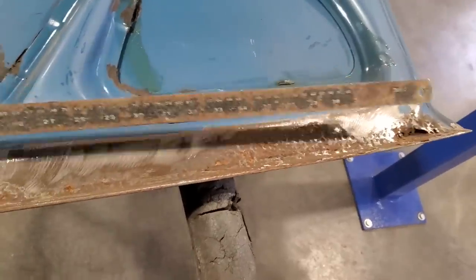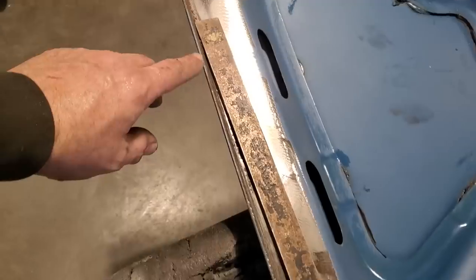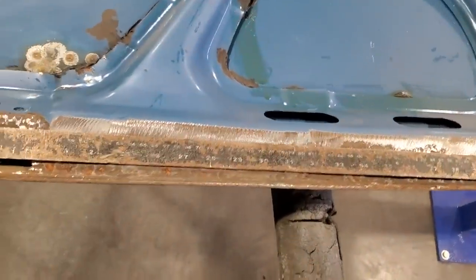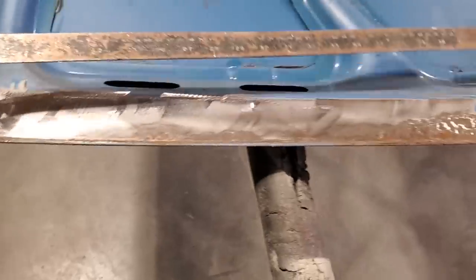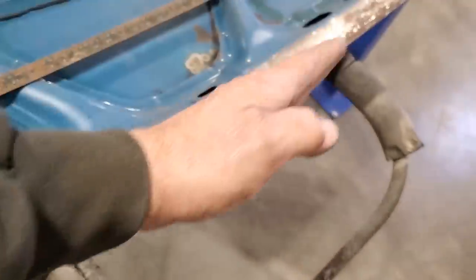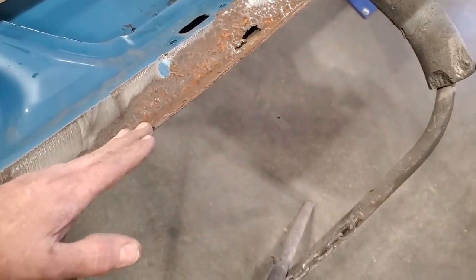The problem with this trunk lid, if you look at this here, see the distance here? Touches over there. Touches over here. So this is not a right angle. Even if I did it in two pieces, it's still got a curvature going through the whole trunk lid. So you've got to take into consideration that it has a curvature this way here. Now it's flat going this way, and it's about a 45 degree angle here.